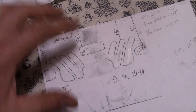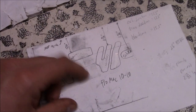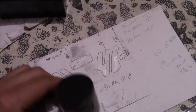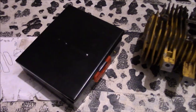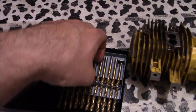Now you're probably saying, hold up, you can't have the ring get into this exhaust port, it's going to break immediately. And that's right. So to solve that ring snagging problem, we're just going to make our own locator pins in the piston to keep that from happening. And I've heard of this being done before. I've never actually seen it done.